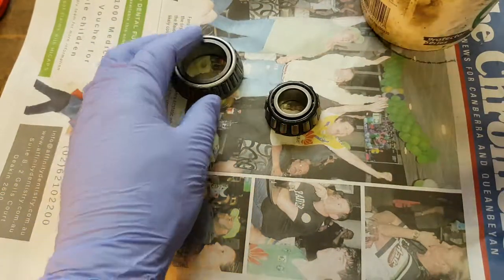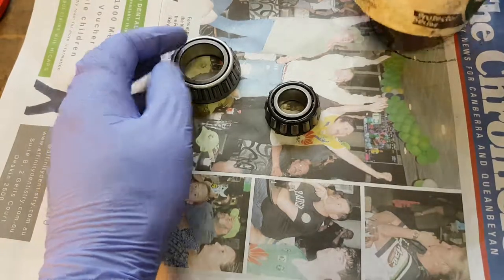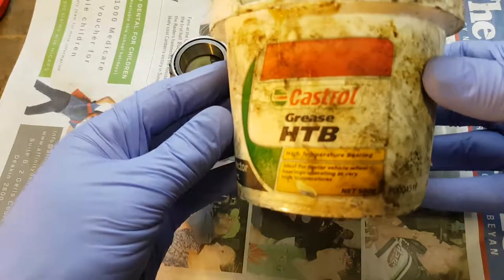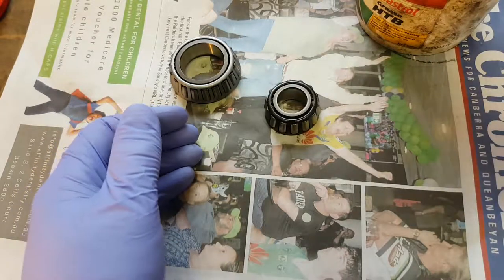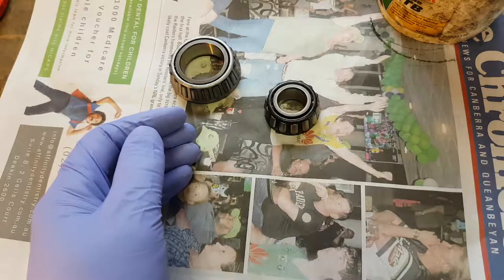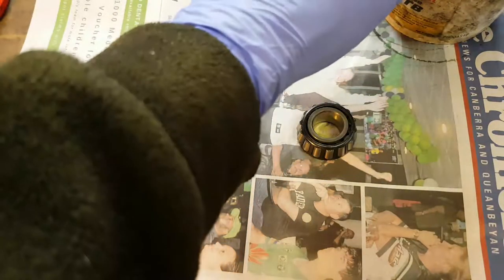Both pretty good for emergency replacement. So what I'm going to do is fill them with grease — this is just standard bearing grease, there's not much there but you don't need a whole lot. I'm going to put them in the little toolbox on the tongue of the trailer, just carry them around in case I run into trouble.